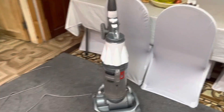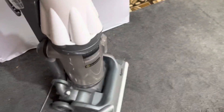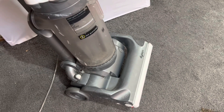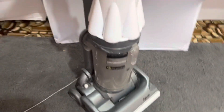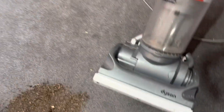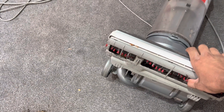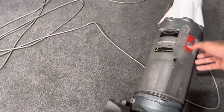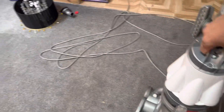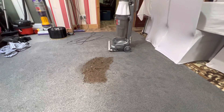One of the neighbors has dropped off this lovely white DC07 — I've not actually had a white DC07 before, believe it or not. It needs repair, so I'm going to try and diagnose the problem on camera for the first time. Visually I can't see anything wrong with it apart from underneath: the brush bar belt seems to be intact although a bit loose, possibly needs a new belt. Let's switch it on and see what's wrong with it.